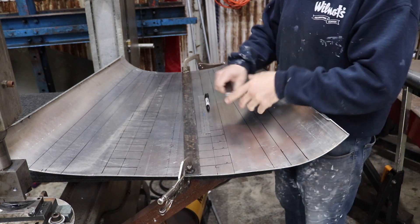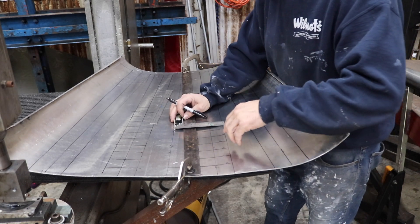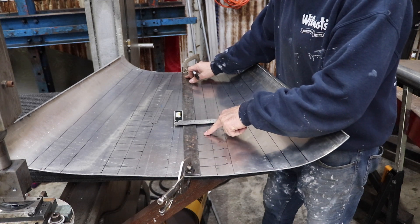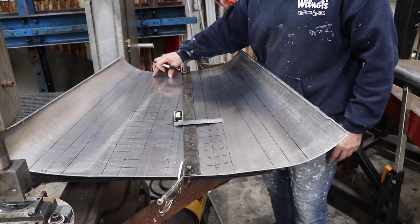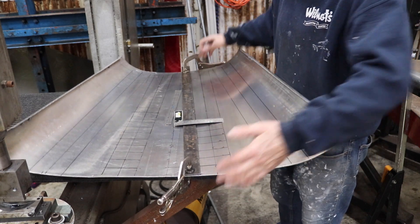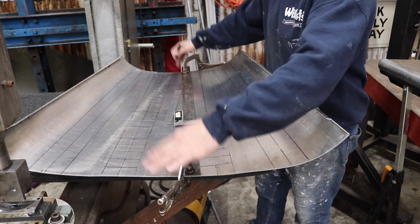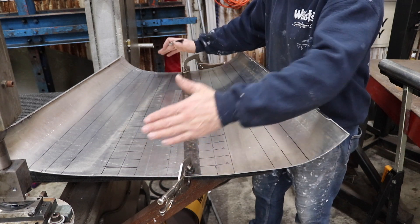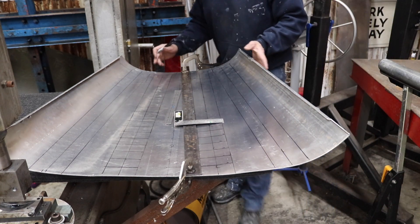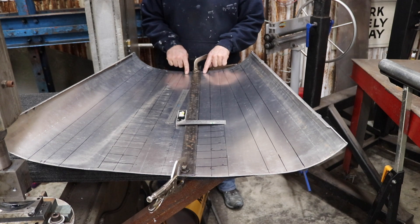What I'm doing — you guys saw me do a little bit of a layout on my deck lid for the 27 roadster — so what I'm doing now is I have my straight edge, which is also a ruler. These louvers are going to be spaced an inch and a half apart. I already have this first row laid out and I'm going to continue the rows all the way down to the front. I'll leave a space of an inch and a half on the back and an inch and a half on the front, because the hood still needs a little bit of trimming. I've got my center mark, measured in an inch and a half on each side, and I'm going to do my louvers from there.